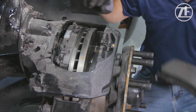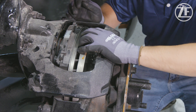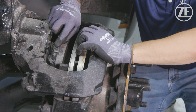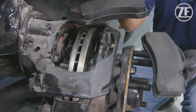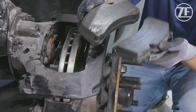The outboard pad slides out straight. The inboard pad has a two degree inclination on it, so you have to push this caliper inboard, slide the caliper in, then pull the pad straight out. Now our pads are free. We can check our pads for any abnormal wear and see how they're wearing overall.